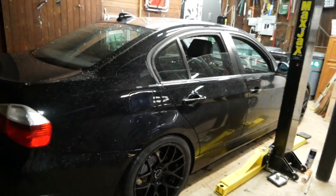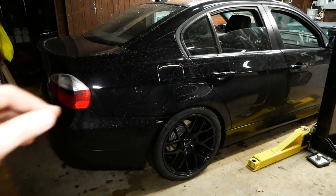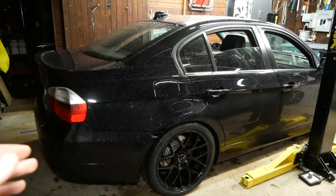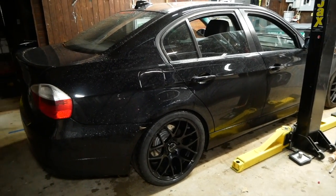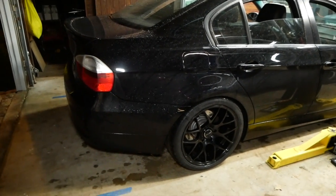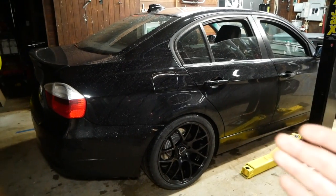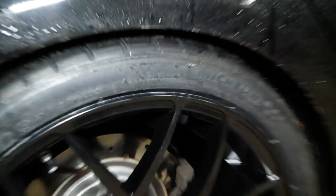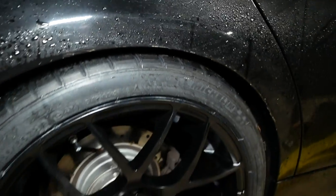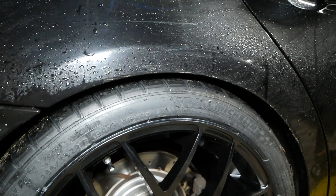Back from my test drive. The first thing I noticed pulling out of my driveway was that the slightly larger tire diameter made a noticeable difference in how the car drives, gear-ratio-wise. Previously in first gear I'd rev out to around three grand by 10 mph, but now I can comfortably drive in first gear around parking lots at 10–15 mph without surpassing 2000–2500 RPM. I also noticed a difference in the driveline ratio on the street — not entirely sure how I feel about that yet. As for wheel rub — yes, there was a little bit, and I could hear it in the car. I'll need to measure and purchase the right size wheel spacers so I'm not wearing away the tire and fender.